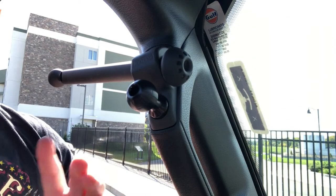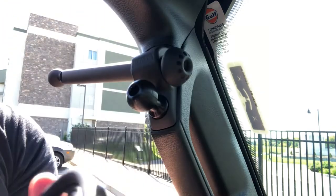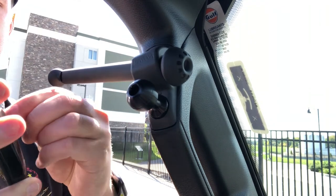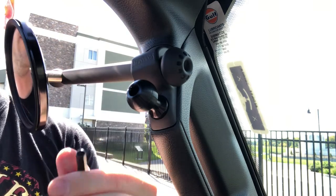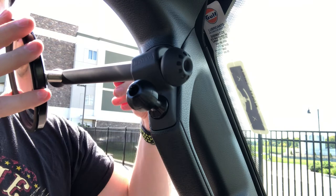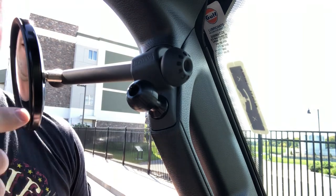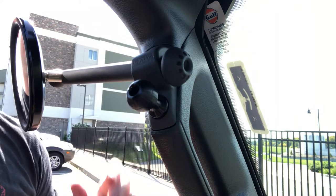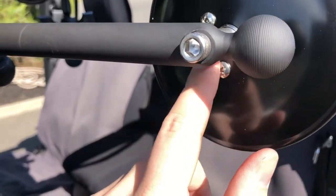Now take the mirror — there's a caution sticker that says to keep hands off the glass when adjusting and to loosen the bolt if necessary, so you don't scratch or mar the lens. Thread the mirror onto the arm, get it thumb-tight, then use your six-millimeter Allen key to tighten the mirror attachment to the arm. Note that it's not the same Allen key for all components — I think that's intentional for security. Once adjusted, use your Phillips head screwdriver to tighten down the three screws to keep the mirror fixed in place against wind.